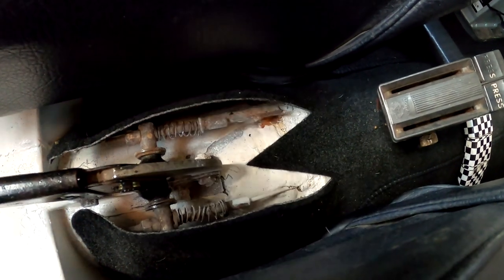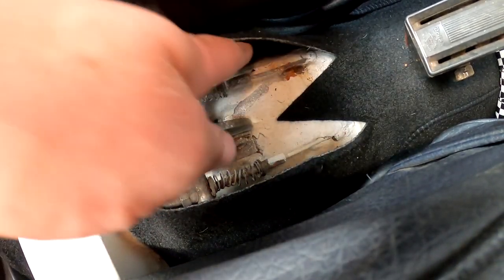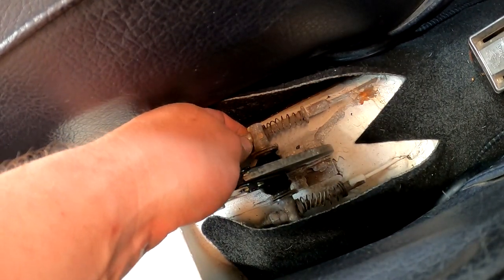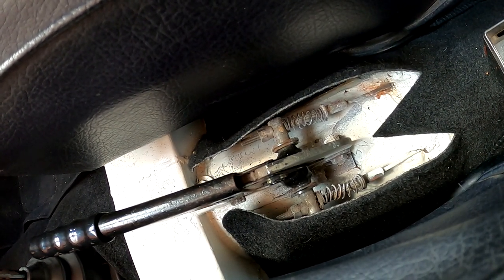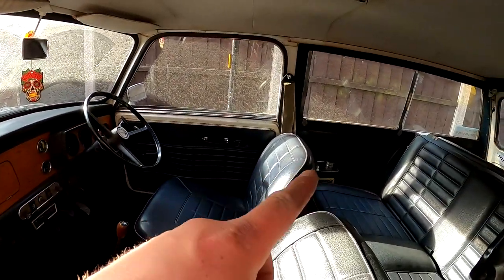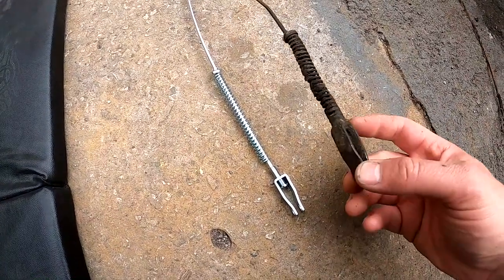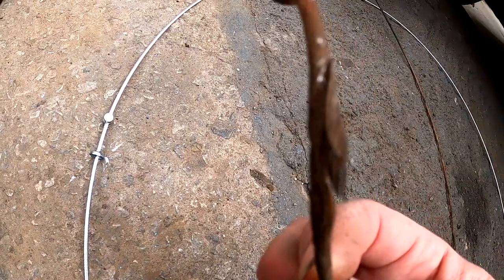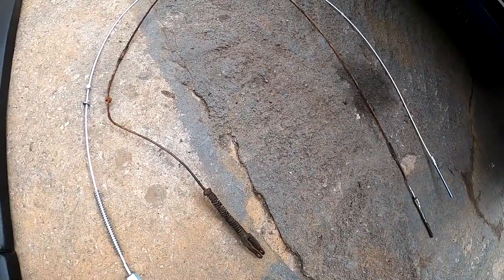While I'm in here, I'll show you the handbrake cables. You can see they have two cables going onto them — it normally has a little union back there and then it splits off. You can clearly see that one's absolutely snapped — a bit corroded, it looks fine but we're going to swap them out. It's just a case of threading the new one all the way through from the back onto the back of the drum. The interior of this car is basically finished now — I really want to get some door cards for it. I managed to get the old one out. There's a little clevis pin that goes through that joint — it started to fray and was quite threadbare, so it was going to go regardless.